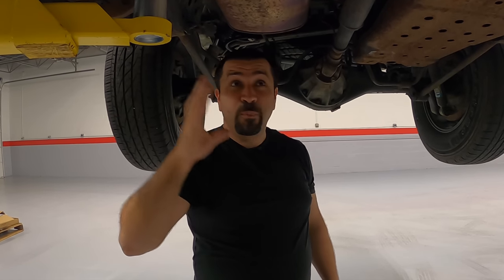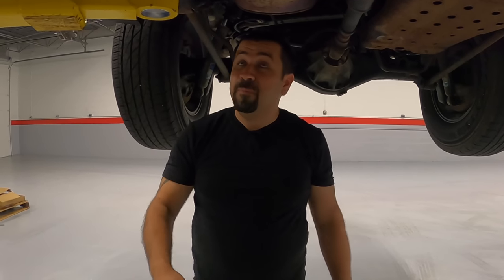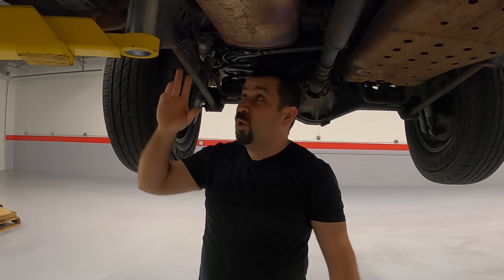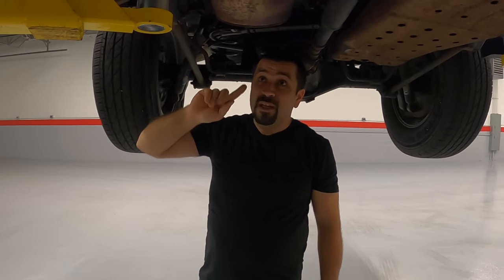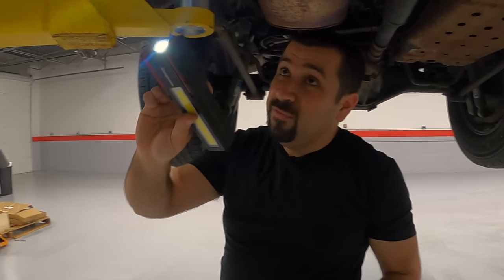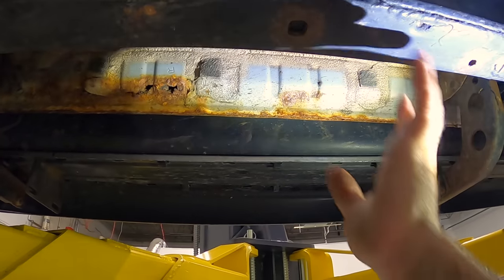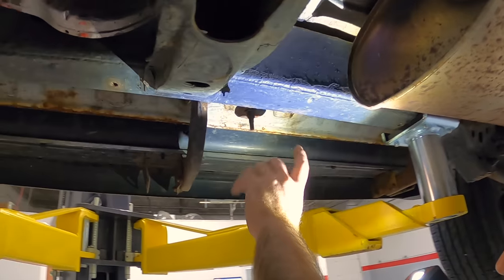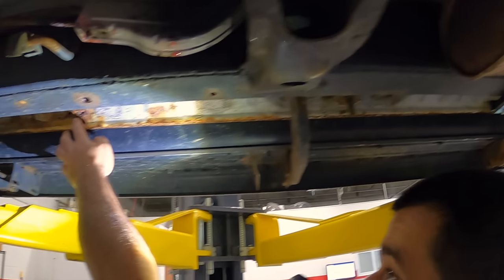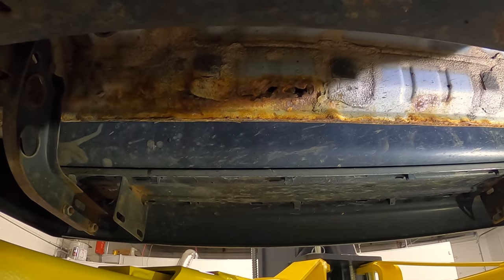Usually you'll see these with 60,000 or 70,000 mile beautiful pristine interiors — looks like nobody's sat in them, everything else in the truck is beautiful. You lift the truck, look here, it's all rotten, there's a big hole. Avoid these trucks. Now that you've looked at the frame — the frame on this one looks good. The owner truly took care of it, because if you look at the body, you actually have some holes from rust and the body is rusting, but the frame is good. This is a very rare case. The owner focused on the frame and didn't worry too much about the body, because this is a body-and-frame truck and the body rust won't cause a structural issue — but if the frame is rotten, it's going to break.